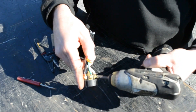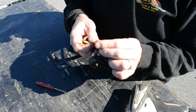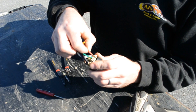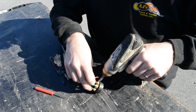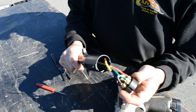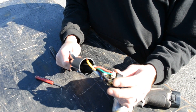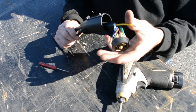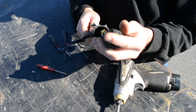Last, we have the red wire, which is left turn — could be red, could be yellow. You're going to end up with one wire left over in this case because we do have a 7-cord. This wire is used for an auxiliary circuit — could be reverse lights, anything else you want to power up. We're not going to hook this one up because 99% of trailers do not have that wire wired into the 7-way.